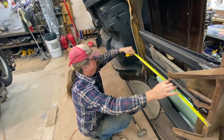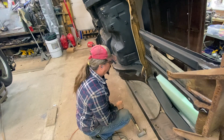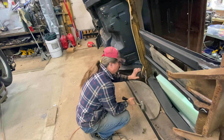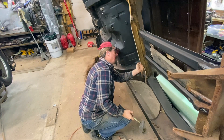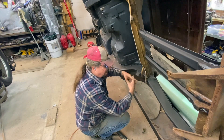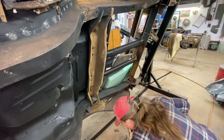Measuring here, here, and up here — 30 inches. We're close, we're off by less than a quarter inch. There's nothing I can see it's hitting on, but it won't pop up any further than that. I see why — I need to bend that right there. There's a little lip there from where the two pieces of the frame came together, so I just need to knock that just a little bit. This end is just falling like it wants to be there. It's perfect. That took care of that issue. I'll go in and knock that in place after I get it tacked.